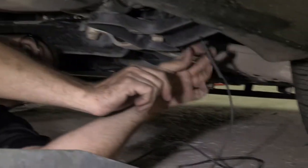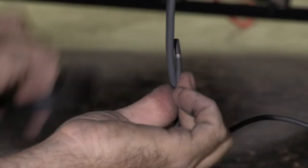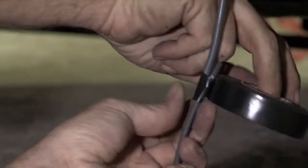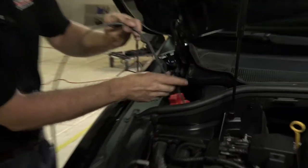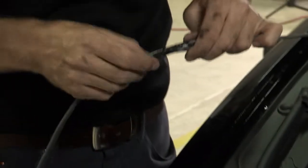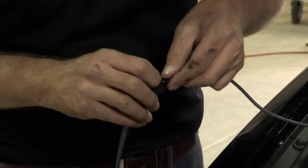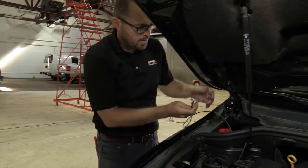Back underneath the Durango, I've got the end of my fish wire. I'm going to mate this up to the power lead running to the back of the vehicle with a couple turns of electrical tape. It's important when you're doing this to get up and over the end of that wire to make sure it doesn't come loose as we fish it back up top. I'm going to bring my fish wire back up along the firewall, then remove the tape that connected the lead to the fish wire. With the fish wire disconnected, I've pulled the wire up, putting some tension on it up the firewall so we know it's not loose.